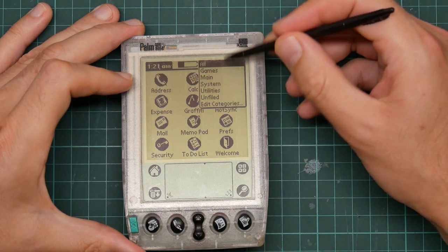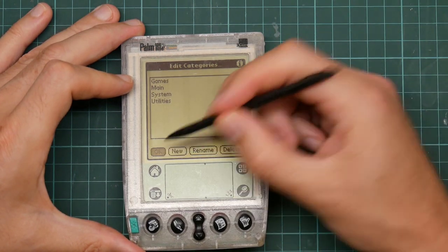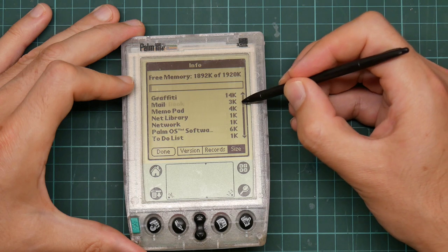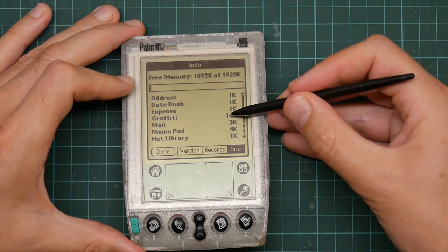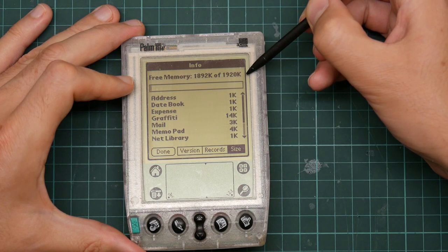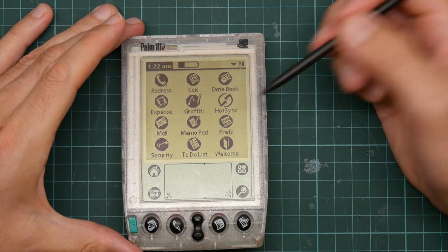You can categorize your applications. Because there's no external storage, the only place to put applications is in RAM. Let me go to info here — this will show you the size of the applications. Most of them are very small because they're just pointing at ROM. But graffiti here at 14K is, I believe, the actual size of the application — I've managed to beam that to another device and it does actually work. So out of the box I'm using practically none of my two megabytes of RAM. Compare that with an Android device. That is the Palm 3E.